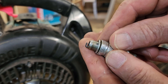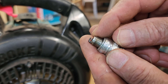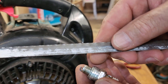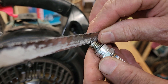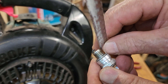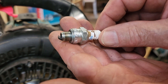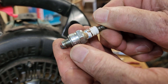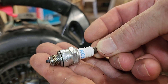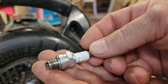I've just checked the gap — the book actually says 0.7 to 0.8mm, so the gap's not so bad. If you don't have a feeler gauge, an old hacksaw blade is a good guide — generally any small engine will run fine if the gap between the electrode is around about a hacksaw blade thickness. I noticed it's quite grotty around the top so let's clean that up. It's an NGK CMR6A and I would say that's probably the original plug.